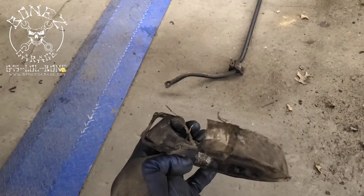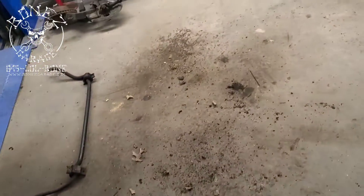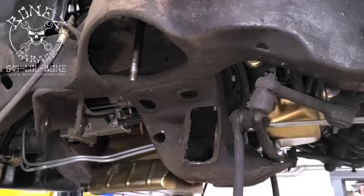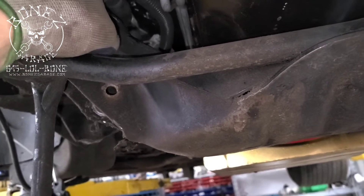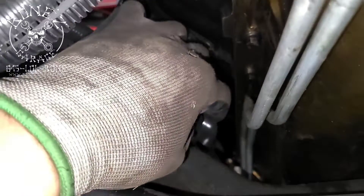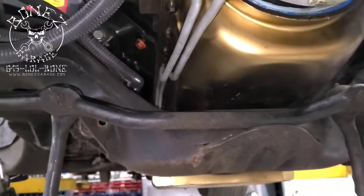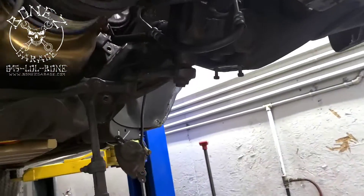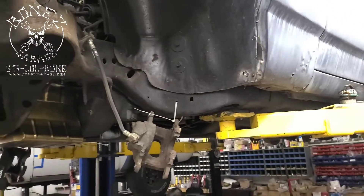To make up for how low they made these springs, they tried putting spacers on the top of the spring — so it's just a really bad situation they've created. We're going to fix all that up, make it safe, and make it right. You can see the positive cable is going to get attached with a clip right over here on the bottom of the motor mount — there's a bolt right there. We're coming along really nicely with this car and I can't wait to get her finished, get her started, and get her on the road.